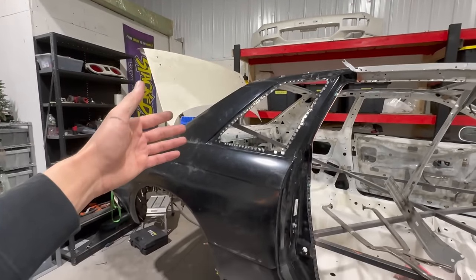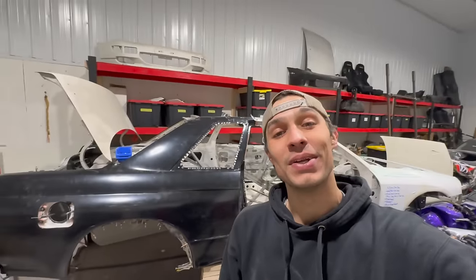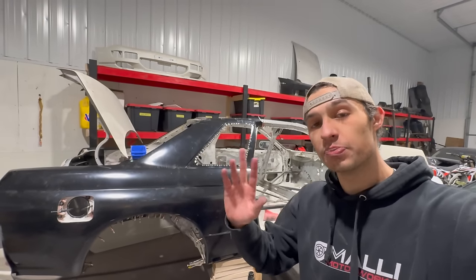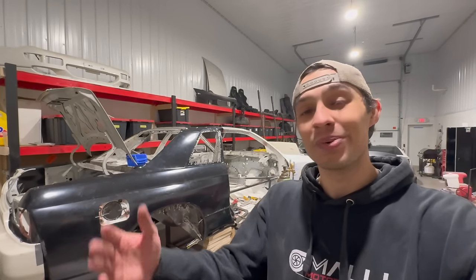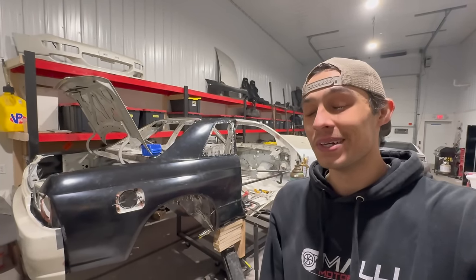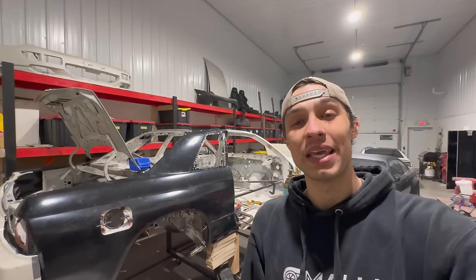All in all, guys, I couldn't be happier with how things are looking. This beats plug welding any day — no hole drilling, just straight-up fusion welding. It's pretty incredible. The fact that we now have so many spot welds in these areas is going to add rigidity without a doubt — I think we already have about 27 just from here down, so we already have about double. Panel bond takes about 24 hours to fully cure up, so we're going to let that do its thing. We're halfway there — we've got this quarter panel done and then we've got the other one of course. Making steps in the right direction every single day is the goal. I appreciate you guys for watching — let me know what you think in the comments below, throw a like, and I'll catch you guys in the next one. Have a good weekend. Later, guys.